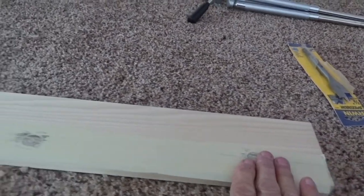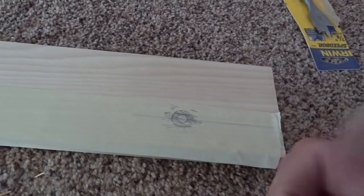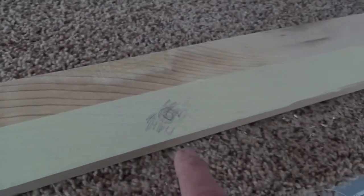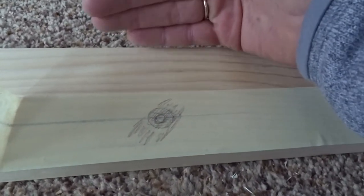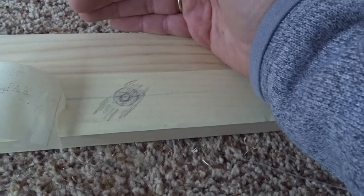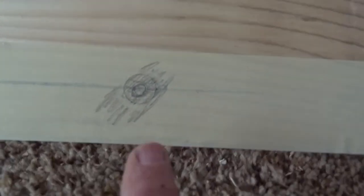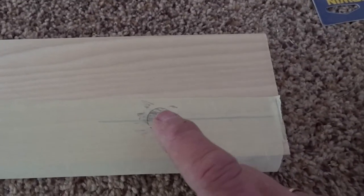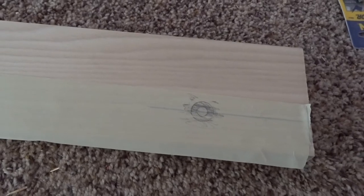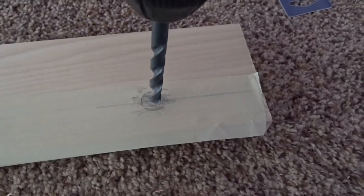Precision is not my forte, but I put the masking tape on the piece of poplar. I measured from the floor up to find the center hole of the rivnut in the van. Some holes are at the same height and some are a little higher, so I measured up from where I need this to end up — 33 inches from the floor. I figured out where the middle of that hole was, drew a line there, and lined it up so the middle went right through that line, then drilled through the holes. I'm using a quarter-20 bolt, and since I tend not to be precise I'm using the next size up — five-sixteenths.